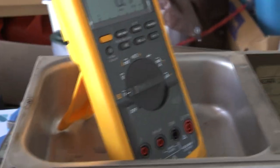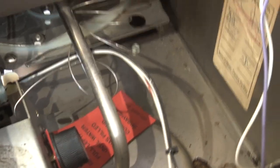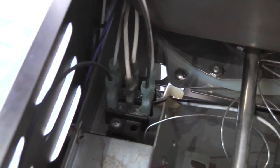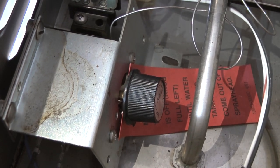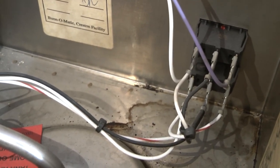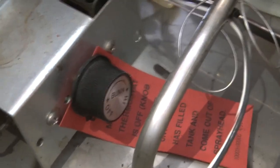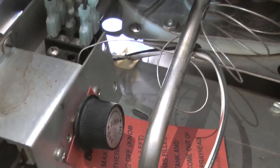With the machine open, here's the boiler — that's just a side panel. Here is the internal of the machine, which has the serpentine: the small serpentine is actually the wire from the thermostat. There are connections here with a bus terminal, and the thermostat control. This thermostat control was set to high. I think that's what explains it being forever powered on — the boiler never stops working. I'm going to regulate that so it can have something more meaningful. And these are the two switches for the heaters, for the top and bottom heaters. These are working fine. So what I need to do is just do a minor regulation and change the outlet.